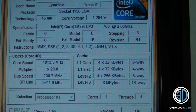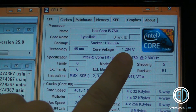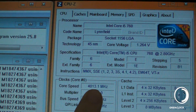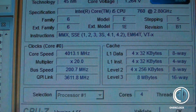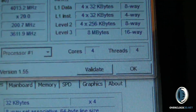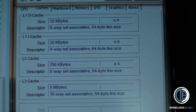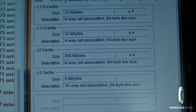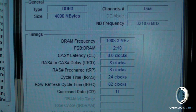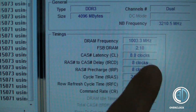Right, here's CPU-Z. In the BIOS we're actually set at 1.25 volts, and that goes up and down depending on load line calibration as we spoke about before. You can see we've got 4 gigahertz core speed, 200 bus, 20 multiplier. The specs show it's got 8 meg L3 cache just like the i7s. If we go down to the RAM speed you can see it's reading 1000 but obviously that's times two, so it's running at 2000 megahertz.